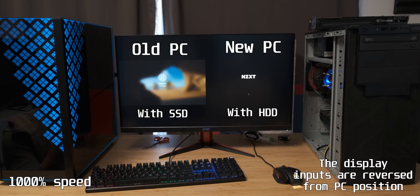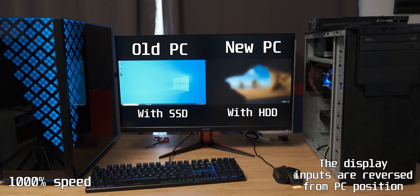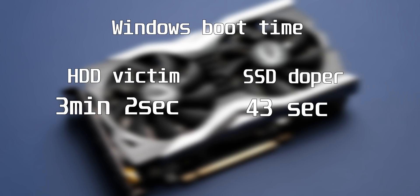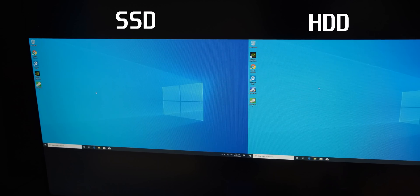After installing Windows, I did a basic setup — just graphics card drivers, Google Chrome, and Steam on both systems — then did a boot speed test. As you can see from the footage, it's not going well for the new system. That hard drive is really crippling its performance. I redid this test three times and got the same results every time. The terrible hard drive has a huge effect on boot times, and even once it's booted into Windows, it takes quite a long time for the system to become usable and responsive. But once settled, basic things like launching the Start menu are about comparable to the older system.